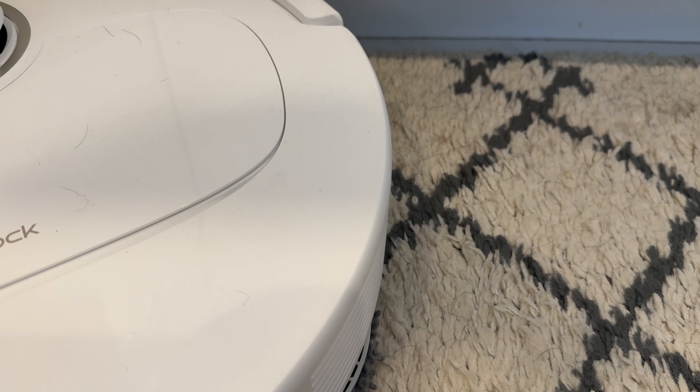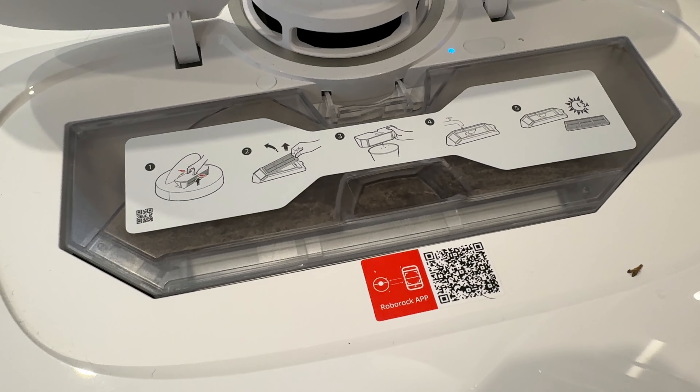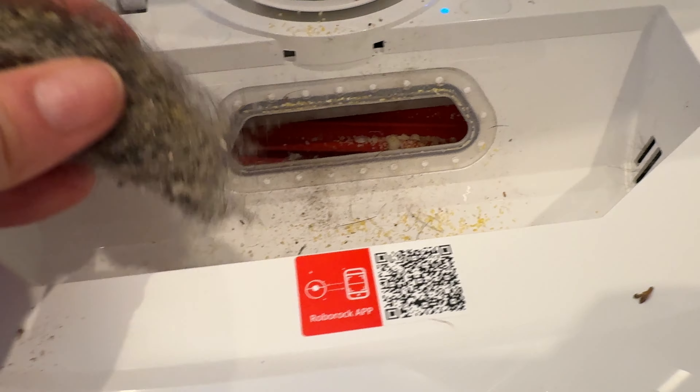So, is this the end of this review? Not yet. Puzzled about why such an advanced vacuum would be struggling so much, I decided to just double-check the onboard dustbin. Now, despite the fact I'd only had it running for about five minutes before I did this, I was surprised to find the dustbin was crammed so full there was absolutely no room for any more dust or dirt inside. This is surprising because the robot is supposed to manage the emptying of its onboard dustbin by itself, and most robots will empty it after every cleaning run. It seemed to me, though, that it had been running all week in my house but never once emptied itself. Since the dustbin was crammed so full, it was impeding the suction by a lot.